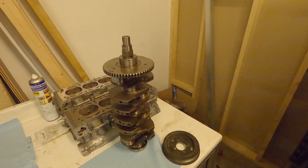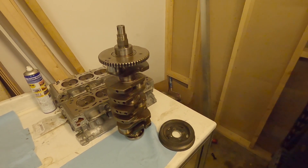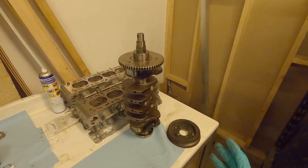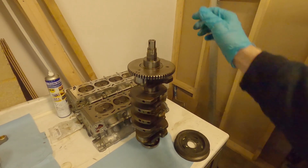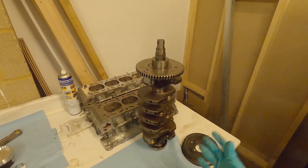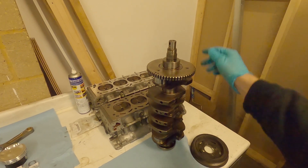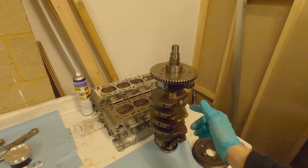You can't really balance your crankshaft yourself — you'll have to go to a machine shop. People sometimes just take the crank down and get it balanced on its own. But if that crank has a slight offset mass and you bolt a flywheel with a similar mass offset on the opposite side, they'll cancel out. However if you bolt the flywheel the wrong way around you've got one bit of mass here and one on the flywheel adding together, increasing the forces on the crankshaft.